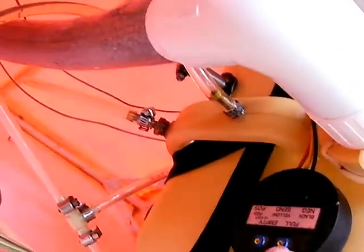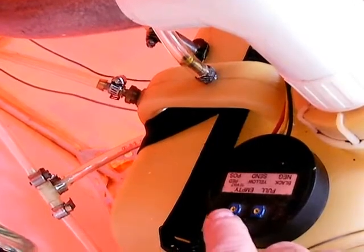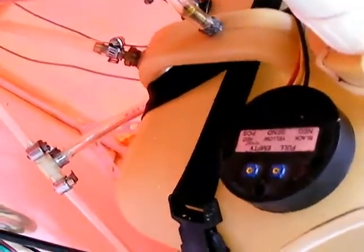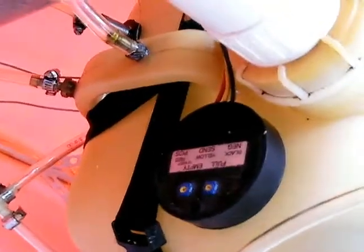You can go through the cargo door to get to this stuff. You'll notice here on the center for the gas gauge, there's a little tiny Phillips head screw here and here — one says for full and one's for empty. You turn those screws to adjust when the gauge reads full and when it reads empty. I've got it set now so I think it'll read empty when there's about only a gallon of fuel left in it, but I'd like to test that a little bit just to make sure.